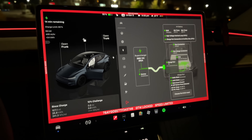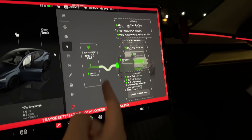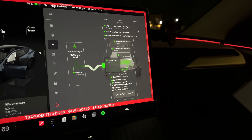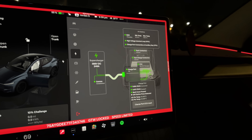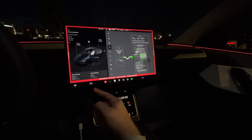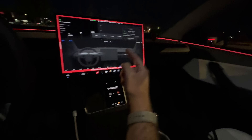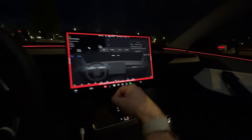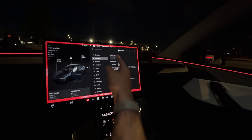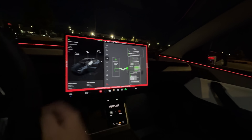True to the test, we plug in right when it hits 10. We'd have just under a minute left; temperatures have settled in at the high 50s Celsius and we've dropped down to right about 250 amps requested. Pin temperatures are probably about as hot as they'll get. We'll be running climate probably at 69 or 70 degrees, between 68 and 72 in its most eco-friendly setting, with passenger and rear vents turned off — even though this has ventilated seats.